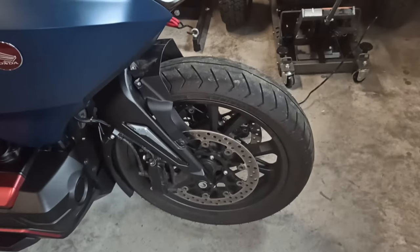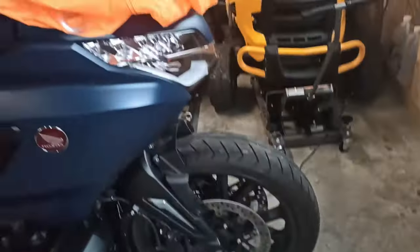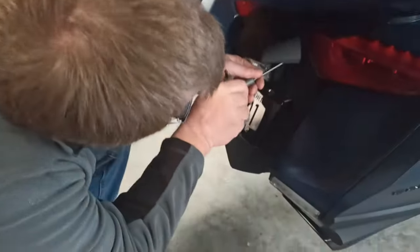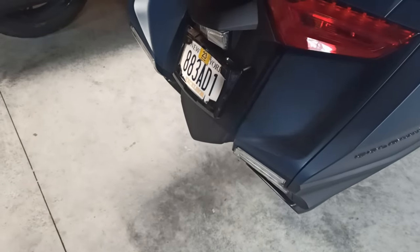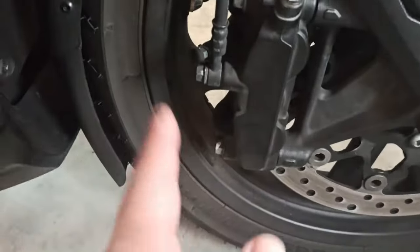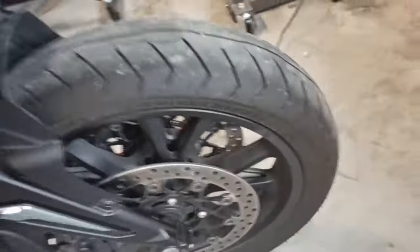All right, front fender. Just took the four bolts out. Front fender's off. You should have tip over guards. Little push pin on the bottom. You pull it out, cover comes off. Now he's in the process of taking out the back cover, and I hate using this one. Next, we'll take the two calipers off. Bolt here and bolt here. Take those off on both sides.